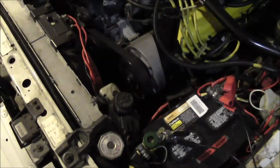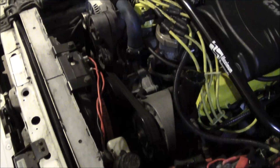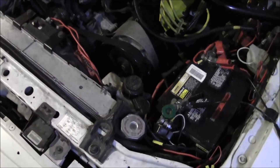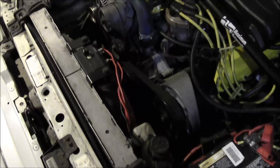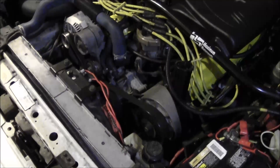This automotive battery is not a deep cycle battery — it wasn't designed to do that. So it's going to put a lot of stress on your battery, make the car a lot harder to start, and reduce the lifespan of that battery. If you've got an electric fan, make sure it's wired up properly with a relay, make sure your battery is maintained and fully charged, and if you're running underdrive pulleys, you might want to consider bumping your idle up a little bit.